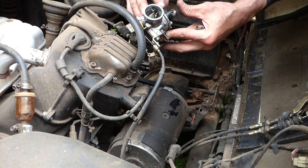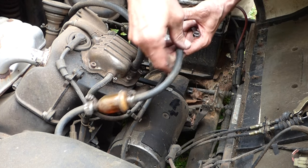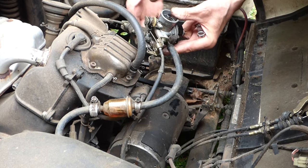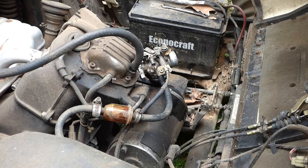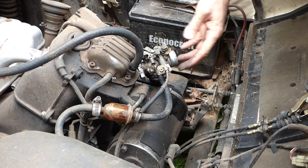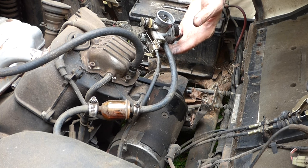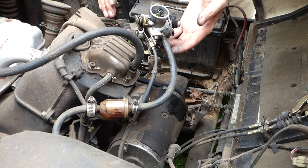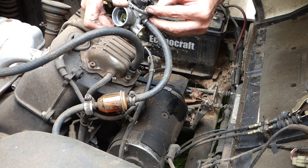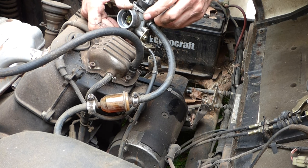The needle is moving in there. See if I can pump some gas through there. Can we look at, in your float bowl? Yeah, that's not good. That'll clog that up, huh? That looks like gel. Why don't you get some paper towels? That's what happens when you get old gas in there, and it just rots out. Yeah. That's been in there for only about 10 years. Or maybe just this winter.